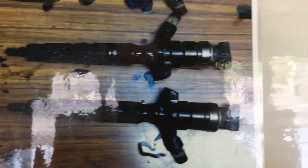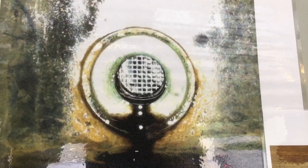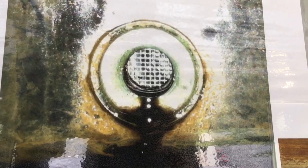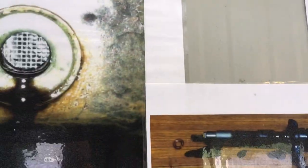That blockage is caused by what you can see here. If you let it drain for long enough, or spray a bit of degreaser in there and let it drain, it's going to look clean like that. If you don't leave it long enough it'll still be black, but it should look like that — a clean oil pickup. This is obviously one that's been cleaned.